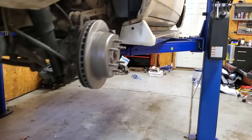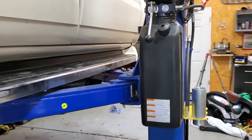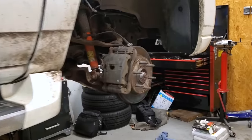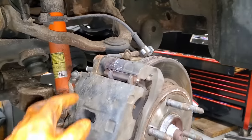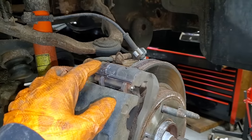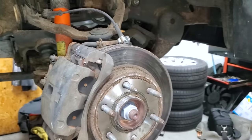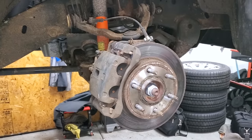Comment down below what holds that in from the factory — but it's in good shape now, it's not going anywhere. And speaking of rust — you guys that live in an area that uses salt on the roads in the wintertime can feel my pain. I cannot get the caliper bolts off for the life of me. I've heated this bracket up like crazy and they will not come out.